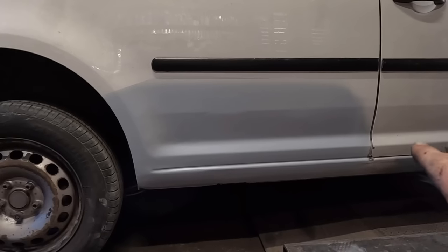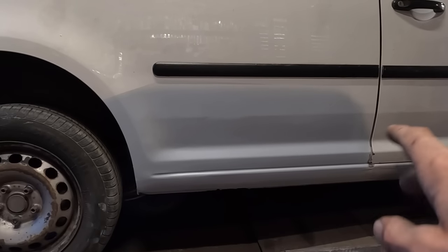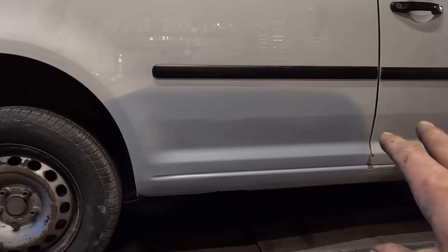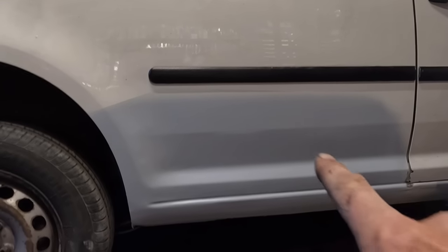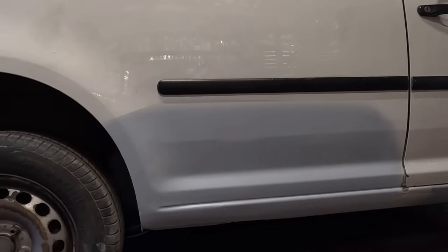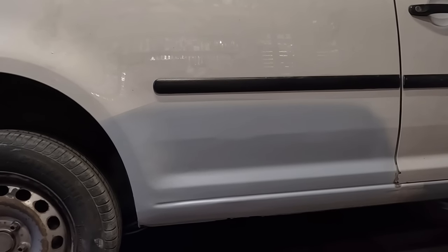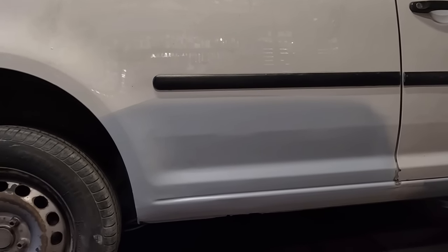We are finished on the rear sill for now. We did a little bit of filler work, then I put some zinc primer, acid etch primer, sorry, then a bit of two-pack primer. The swage line has ever so slightly dropped off, but I believe there's enough primer on there to block that straight. I won't be able to leave that, it will bother me. So hopefully there's enough primer on it.